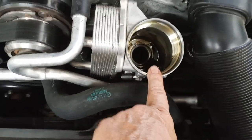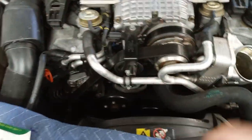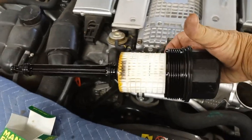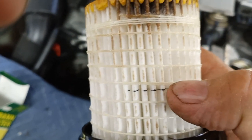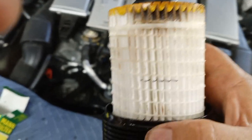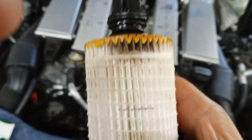After filling the oil back up, here is the hole where the oil filter goes — everything is on top on this car, so it's really easy. You extract the oil from the top and do the oil filter from the top as well. The oil filter is a tube that screws down into the engine. There's a mark on the filter, and there's another mark hidden by the cap — they're equidistant from each end. You push the filter in far enough until that mark is hidden by the cap, so you know it's seated correctly.